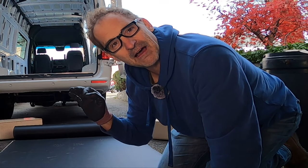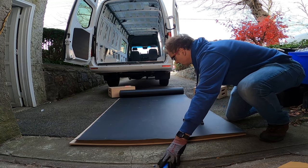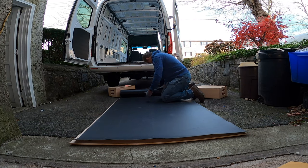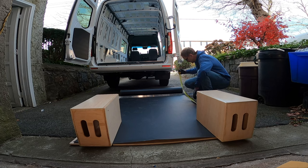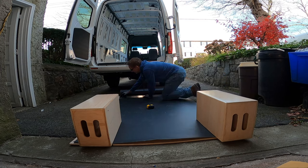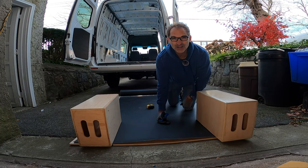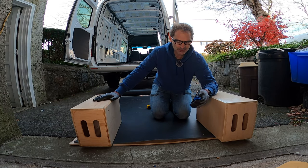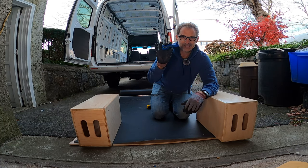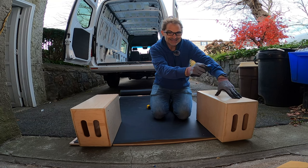Heat, height, and holla — that's where we landed on the sound management theme. I'm going to cut a 70-inch-long piece of this stuff. It's not cheap, so: measure twice, cut once — actually, 70 and a quarter for a little wiggle room. When using a razor blade, think of it like rock climbing: only move one thing at a time, always keep three points secure. Get your brace hand set, then move the knife, then move your hand, then the knife again. You cannot cut corners — razor blades will change your day if you make a mistake.